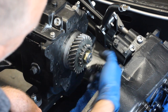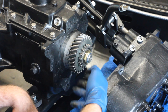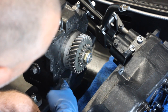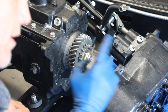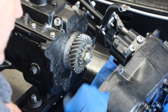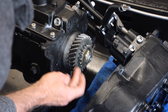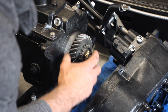There are multiple port holes in the back of the transmission that go directly into port holes on the Dana 20, which means there is fluid transfer between the two. That may be dictated by the gasket you choose — if you choose a gasket that has all of these cutouts filled in, then there's no transfer of fluid between your T-150 and your Dana 20. Take a look at the back of your transmission to see if there are open port holes, and check the transfer holes on your Dana 20, as that will dictate which gasket you're supposed to use. Once you get the gasket on there, grab a cloth and wipe off the gasket material that'll get on the gear teeth.